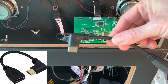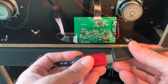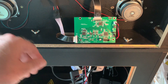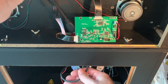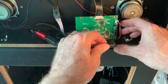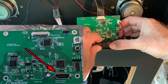I am using a right angle HDMI adapter for the purposes of this video. You don't have to use this — you can connect directly from your computer. But I found it easier to connect my line from the computer to the adapter and feed it through the cabinet. We're sending a 1920x1080 signal from your computer for the backglass. So with my adapter, I feed it through from the lower cabinet all the way around to the front of the switchboard, and connect it to the bottom right HDMI port on the switchboard.